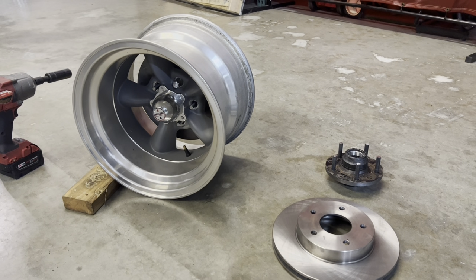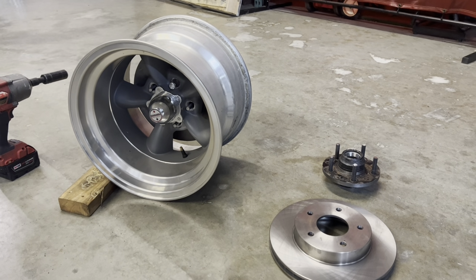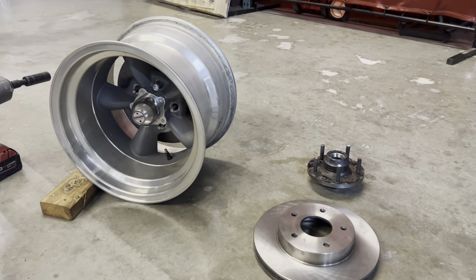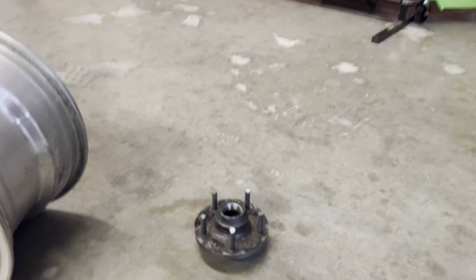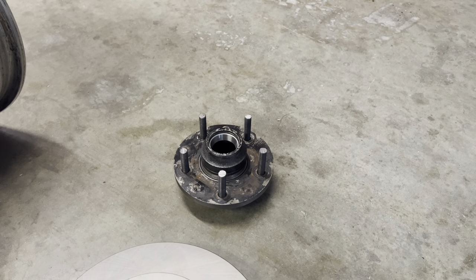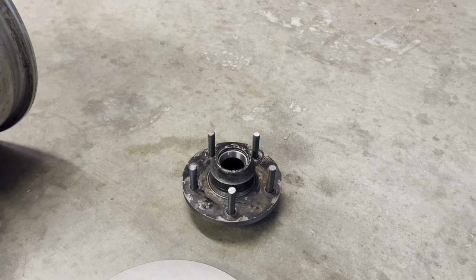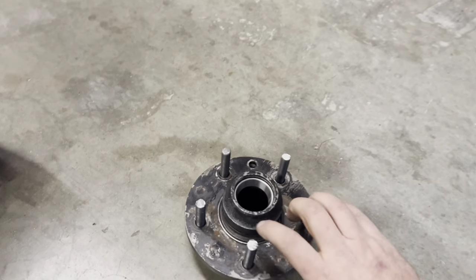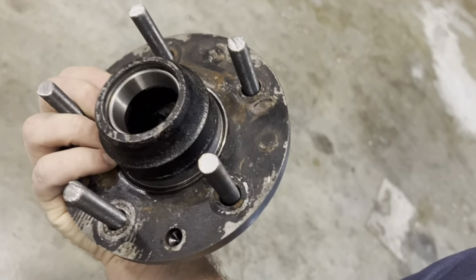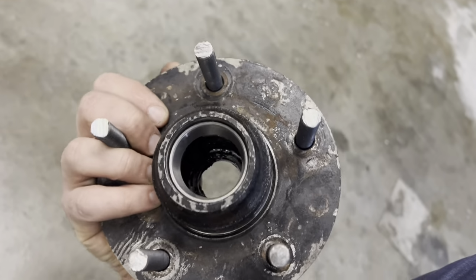So what I am doing now, to keep the brackets and the calipers that I have, is pulling the A-body rotors off and going to this style hub. Most of the OG older generation Tri-5 guys know that a '61 to '68 Impala front hub is kind of a direct swap to a stock spindle. This was an old school trick because it went to the newer style bearings and got rid of the big junk bearings that '55s have. So, '61 to '68 Impala hub.